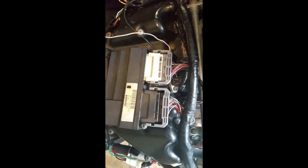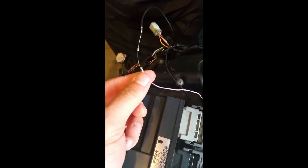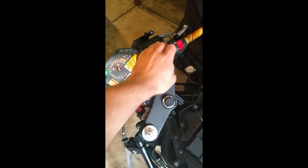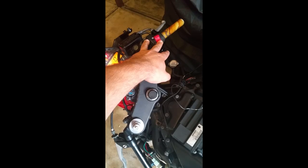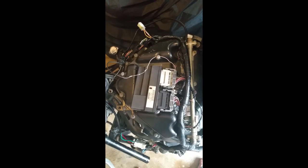I've got the Aussie loom connected to the US ECU and connected that wire with the 3.9 Zener to the brake switch. Now we're going to test if the bike primes. We take the ignition, flip the switch — voila, the bike is officially going to start now. Every single time we're supplying the power to the fuel tank.